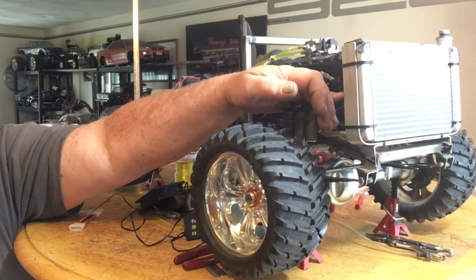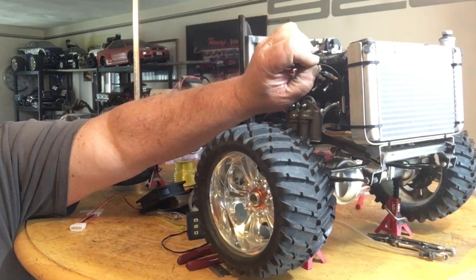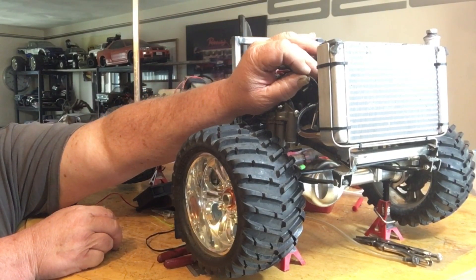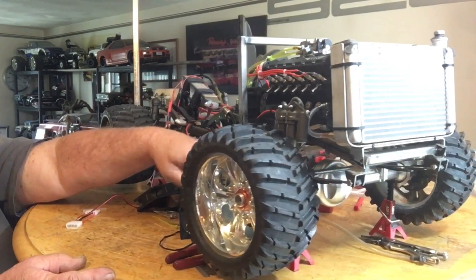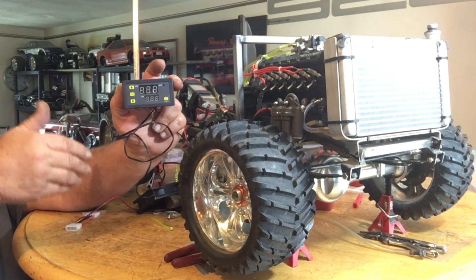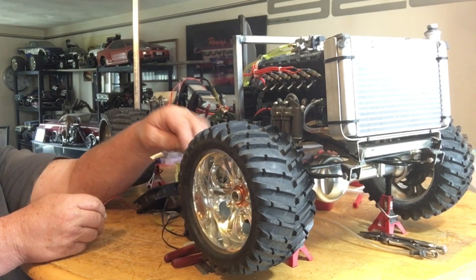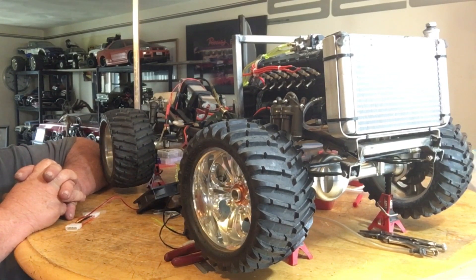I'm waiting for a plastic vacuum T fitting for my lower radiator hose. I want a plastic vacuum T so I can connect the two hoses together with clamps and slide my temperature probe down into the top of the T — that way I get an accurate reading coming out of the radiator into the block. This controller runs the fans and shows your engine temperature; you can adjust when you want them to turn on and off. I bought a ton of these a couple years ago in anticipation of doing these projects. One of my other subscribers put one on his build and it was pretty cool — the fans kick on and off automatically.